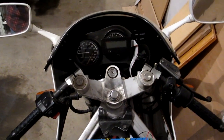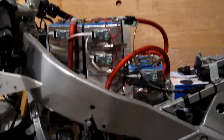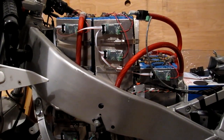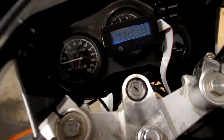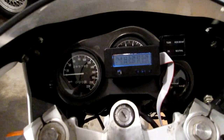There's the display — I think it's time to fire it up. The BMS is on now; I flicked that switch in the back there, which turns on the 12-volt rail on the bike. I think I may have found a glitch as I was filming this video. When I turned on the BMS initially, one of the remotes wasn't responding. I just turned it off, unplugged the remote, hooked it back up, and it was all fine again. I may have a minor glitch in the code for these remotes — it seems like one got locked up when I turned on the BMS.